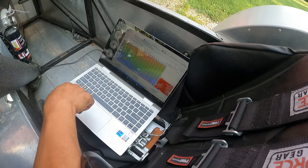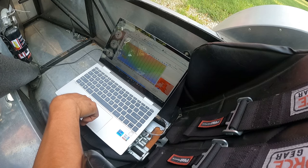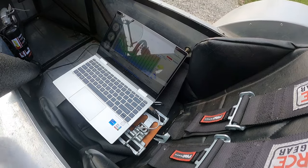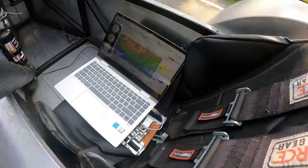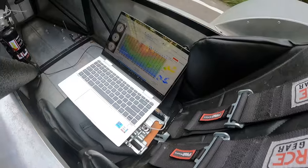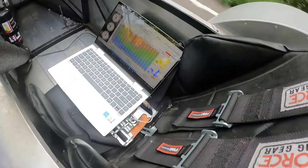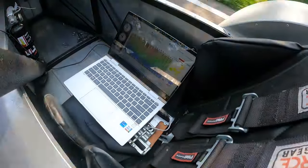Does it have more power than the carburetor? Definitely more throttle responsive, which is what I wanted especially for autocross. I wouldn't say it has any more actual peak power, but coming out of a corner it breaks the rear end loose faster than it would with the carburetor — probably just a function of throttle response and even fuel distribution with all four port injectors working well. I also swapped to a 22RE head which has larger valves than what was on it before, and haven't had any more issues with head gasket leaks. I think the car is ready to go. I'll do some more tuning as we go and then we'll be ready for some autocross. Thanks for watching — if you want to see more on this Lotus 7 replica please subscribe, be sure to like, and we'll see you next time.